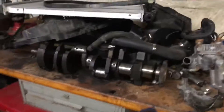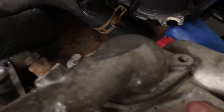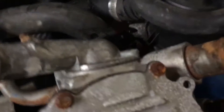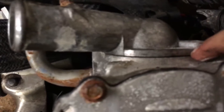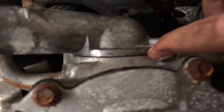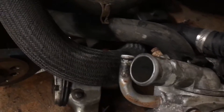Here I'll show y'all the parts. I think we found where the coolant was leaking in that car. You see right there on top — one of the bolts was missing there. And you can actually see, like if I push down here — a little bit of coolant was just laying right there where my finger is. So I think that's probably where it was leaking before.